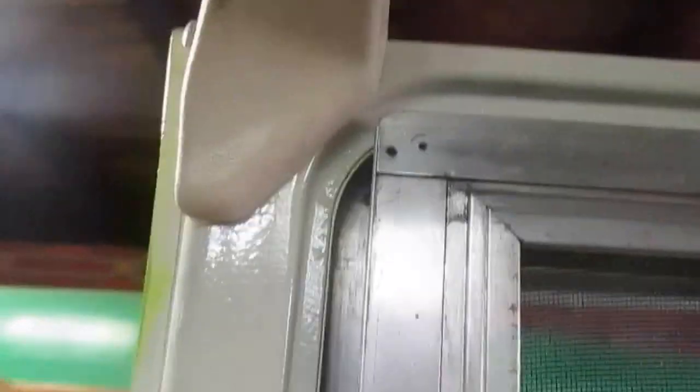Alright, I did all this wrong. First of all, I tried to stick the bottom edge in and then force the top edge in, pushing harder and harder, and it winds up you can't put the top edge in second because it actually has a metal lip behind it. So now I'm going to touch up my paint out there. But this part here is what I was pounding against the edge of the door. So once you do get that in, you just kind of work your way around this seam here, pushing at it with your heel or your hand or whatever.